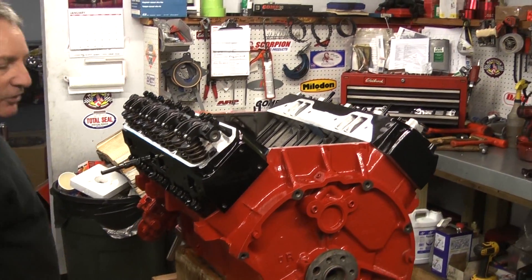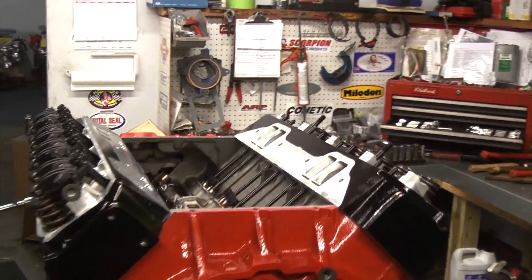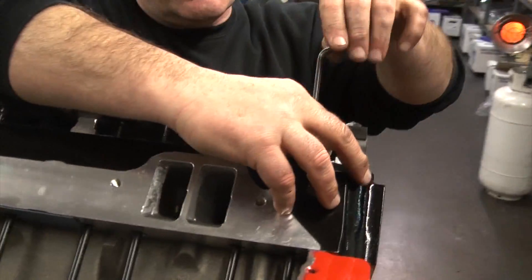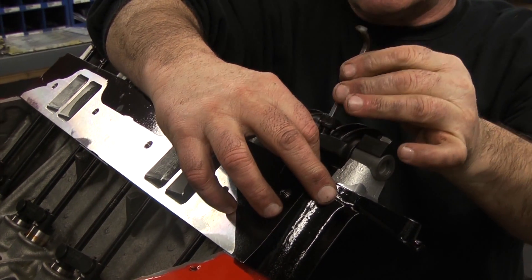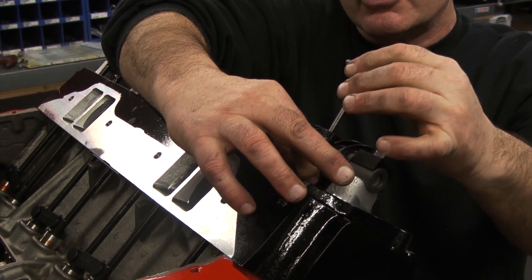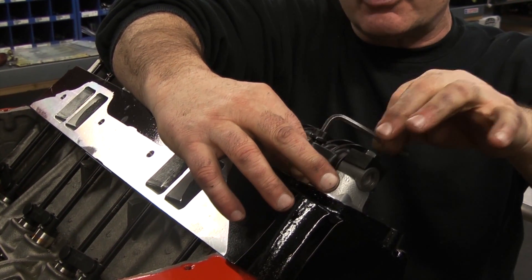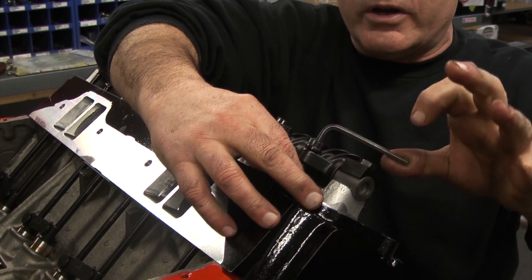On hydraulics, this is basically how we do it. Steve, set me up my wrench. This one has an allen key — we're gonna take the adjustment out and rotate it around. Loosen it up and rotate. Same thing if you're using a stud. As soon as you feel that pushrod start to give a little bind, I like to do it a couple times. You feel it stop, then go about three quarters of the way around.